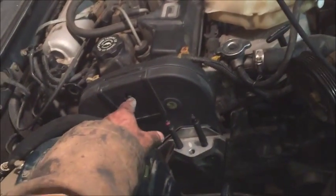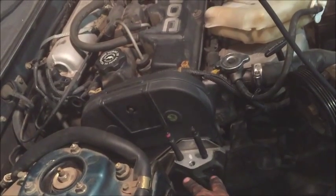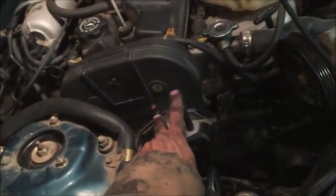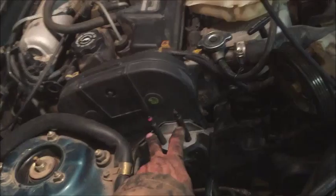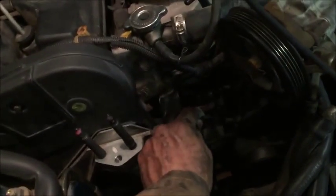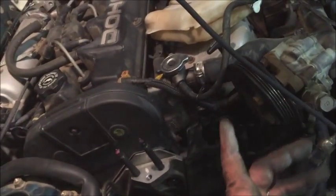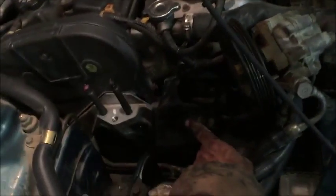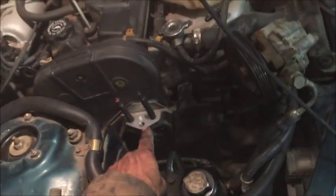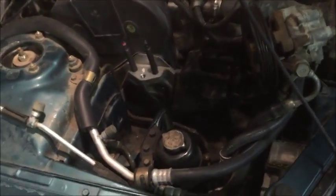So our timing was set. I went ahead and put the cover back on with the 10mm bolts. The three bolts in the motor mount bracket — I haven't put the motor mount on yet, but the bracket that holds the motor mount is on with those three 15mm bolts. Now I'm putting on the power steering bracket — looks like a 13mm in the back right-hand side, a 13mm right up under here, and one on the front side right here. Let's tighten those down, then we can lower the power steering pump itself down inside there.